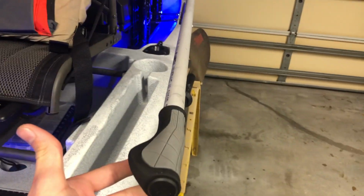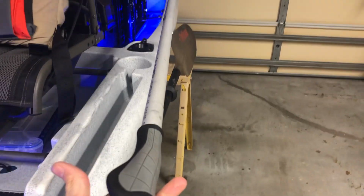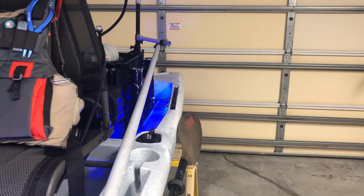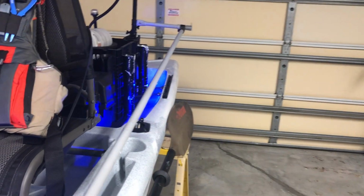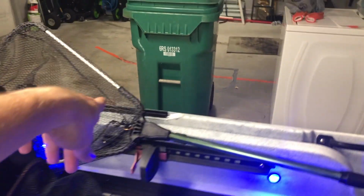And then this is my steering tiller mechanism. When I pull it forward, it turns the motor and the boat will go left. If I push it back, it turns the motor and the boat will go right. I also made it so that if I'm standing, I can hold it as well. And it's very easy to control. It comes with these 2 tracks, one on the side, one on that side. I'll talk about what's on the other side of the kayak in a minute.